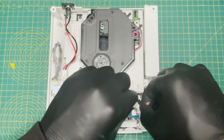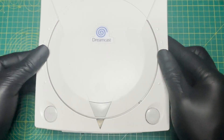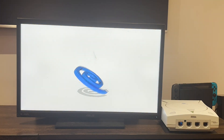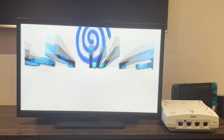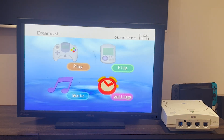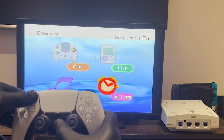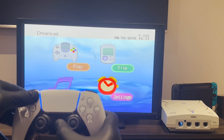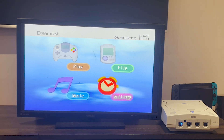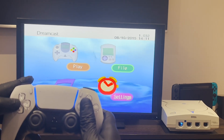Overall I wasn't impressed, but let's sync a controller and show you how it works. Since this is the dev console the intro is slightly different. You'll notice a flashing green LED, and controller port one is also flashing blue — this indicates it's ready to be paired. For this tutorial I'm using a PS5 controller. Hold down the PS button and the Share button at the same time. As soon as the controller turns solid blue and the green LED turns blue, the controller has been paired and you can use it.